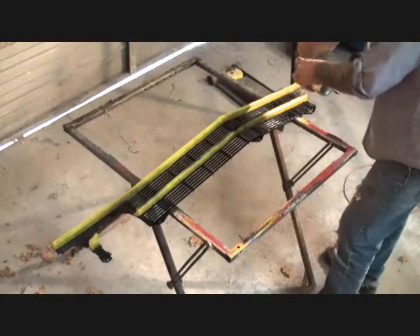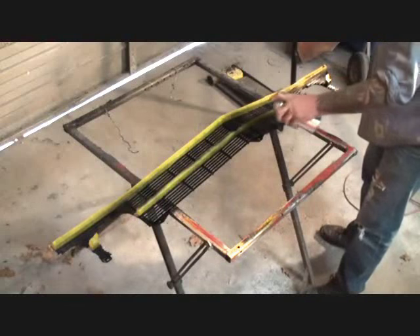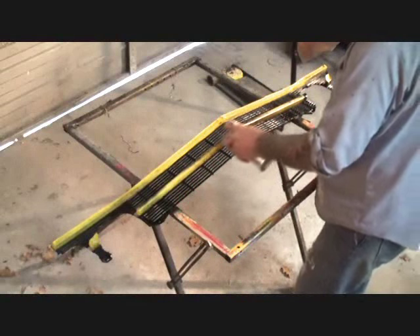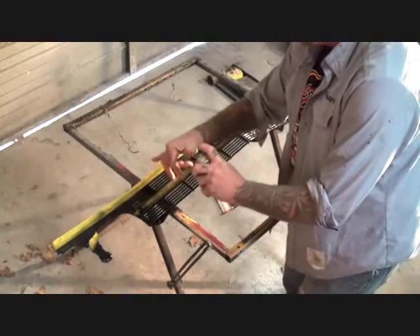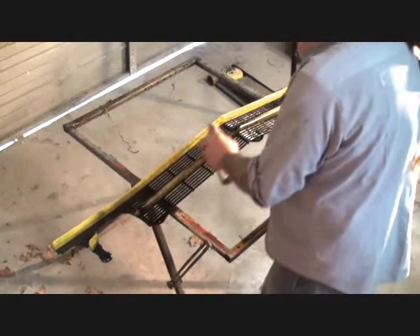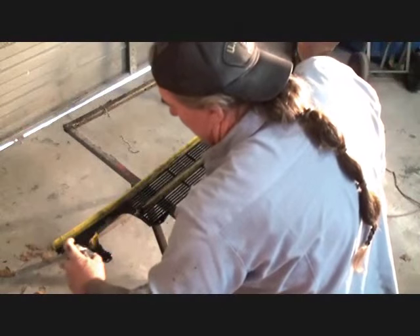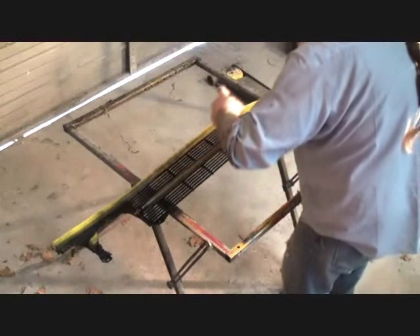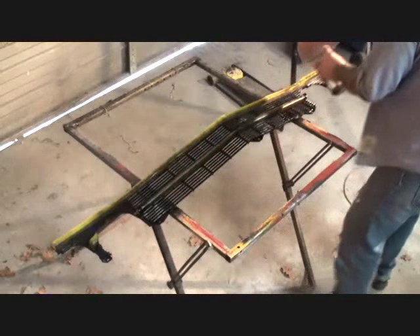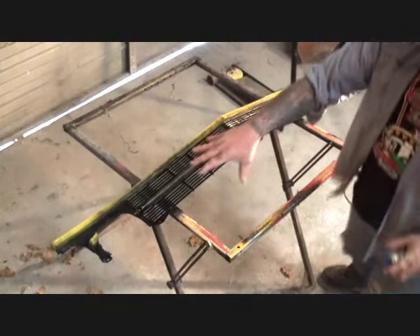This is how you do it — this is what you want to do. We're going to paint it like this, let it dry, then come back and paint two to three more coats. This is the Chevelle now, not a Malibu. The Malibu is the cruiser, the Chevelle is the hot rod muscle car — that's what we're trying to accomplish. Always hold your spray can away at least this far and just move it fast. Put light coats on there — you don't want to over-paint with a thick coat. Just blend it in and keep going — chase the dry out. Make sure you get everywhere, and once that dries I'll come back and repeat my process until I'm satisfied.